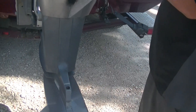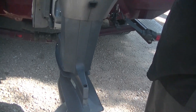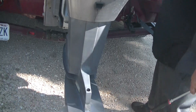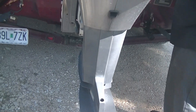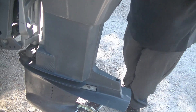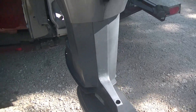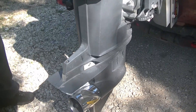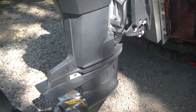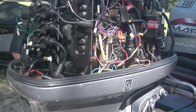Chase put a new water pump and new lower unit fluid in April, the boat's been on the water 13 times since then. It's not leaking, it's going to be fine. The lower unit is one of the more expensive things on a motor - I'd always check that too. Check it for metal shavings and water. Also check for fishing line behind the prop - fishing line is a killer, especially with braided line.